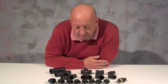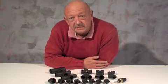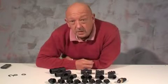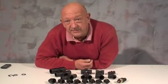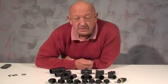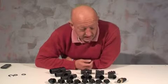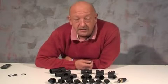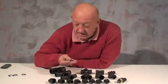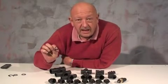We have a small range of modular mix and match connectors that could help you make a neat job of your engine bay plumbing. All these parts are made from glass reinforced nylon and they're resistant to petrols, diesels, oil, and LPG. They simply push together in an almost limitless combination of sizes and shapes, held together with a simple O-ring and a clip.